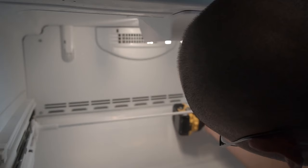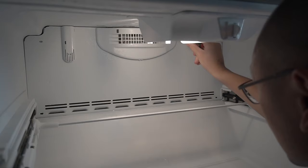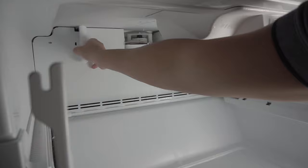This panel is secured by four screws and a few panels over it, so we're just going to unscrew that quickly, then take out this tiny paneling exhaust plate, and then we're going to unplug this refrigerator so that we don't get shocked while working on this equipment. I'm going to take out this cover that's covering the temperature sensor.